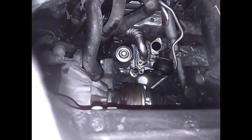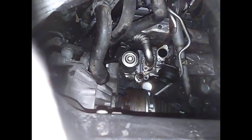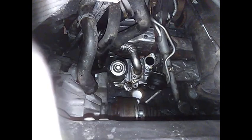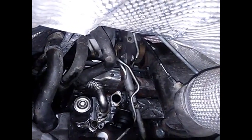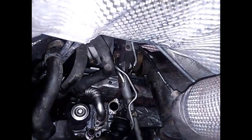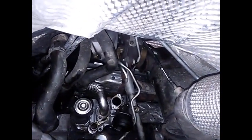Feed for the turbo, and then you can remove the turbo out and replace it. The replacing is the reverse procedure. You also have to remove the V-band on the turbo exhaust, and you have to move all of the exhaust to the side so you can get to the screws and everything.